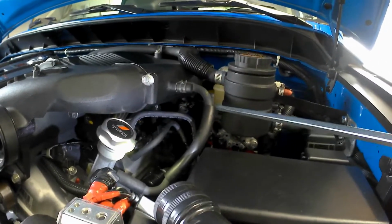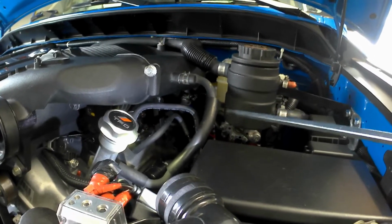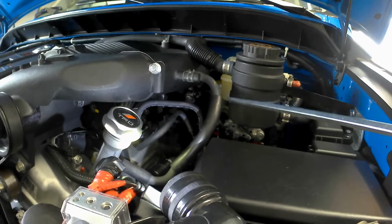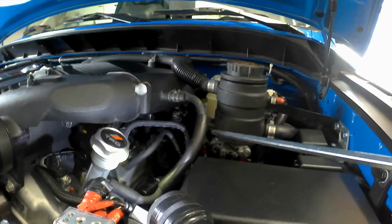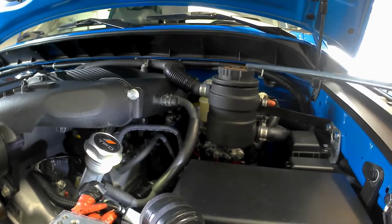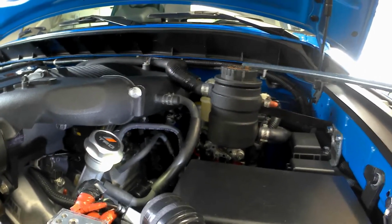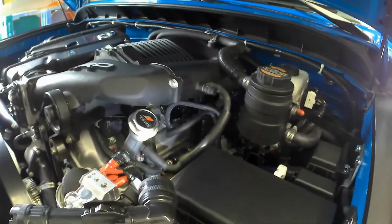Again, SFI, I don't mind it getting burned off with the gasoline. I got no problem with that. It passes emission tests and everything else. But if you have a GDI, you may want to consider putting in an oil catch can. Anyway, don't let anybody just talk you into, oh, you're going to do one. You don't really have to if you have an SFI. Okay, now we'll get back to the other stuff. Just a little bit of lesson there to help you guys out.